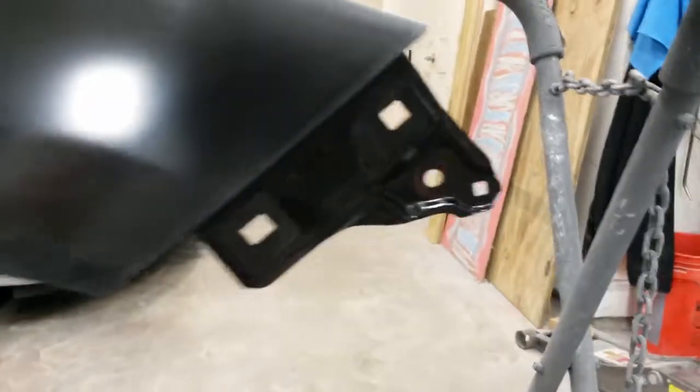But everything else I'll do on the outside. I'll get this when I do the outside. I'll get this part, that way it's all cleared like the factory did it. And I'll go underneath, and when I get it on the car, I'm going to have to mask a line here with some foam tape and spray chip guard underneath after I get the sealer on it. It's got to go over a 2K primer.